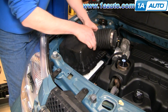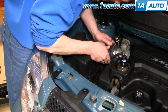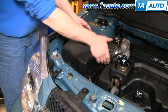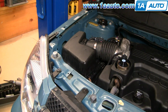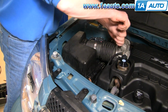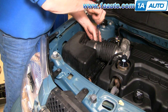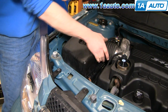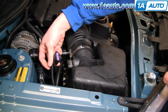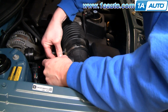And I'll put the outside of the air box in first. And make sure the harnesses don't get in your way. Down in place. Put that back on. Lock that one back on. And make sure that's all back. And tighten up the clamps. And be sure to reconnect that hose, okay, and then that right there, and this little lock inserts from the back like that.